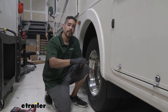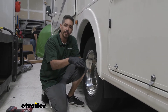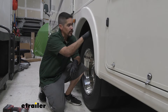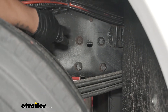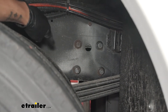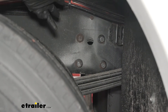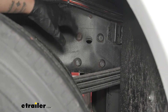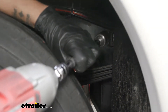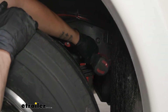To start our installation, we're going to park our motorhome on a nice flat level surface. We want to use our leveling jacks to lift up our motorhome so that we have a little bit more room to work with. We're going to come to the rear wheel well and look directly inside right to the frame. If we look right into the frame rail on the back side of our tires, we'll see that we have four bolts right by our leaf spring. We need to pull out the two lower bolts. Fortunately, there is a keeper nut on the inside of the frame, but there's a tab so we don't have to hold it with a wrench. The easiest way is if you take a long extension and a 21 millimeter socket — typically you can get an impact gun in there — and we're going to pull both of those bolts out.